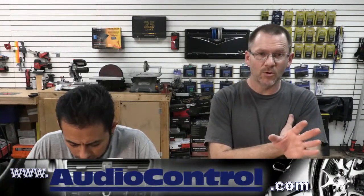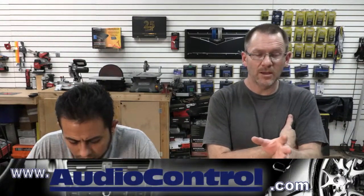All right. So on your Silverado, you have a two-way Flax system. Wonderful system. What should you add to the front? Simple enough. Nick Wingate, if you don't know Nick, he's Mr. Sound Quality. He works for Orca, which is Focal. They own another company called Illusion. Illusion makes a 3.5 with a tweeter in the center, bi-ampable. If you have the power, I would get those. They're not cheap, but if you get the Illusion, then you'll have a true three-way set.